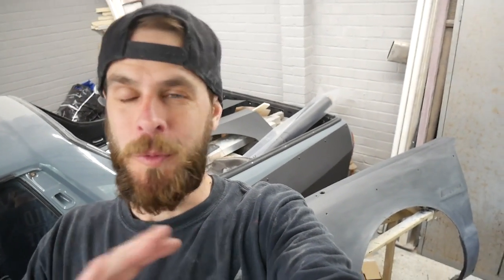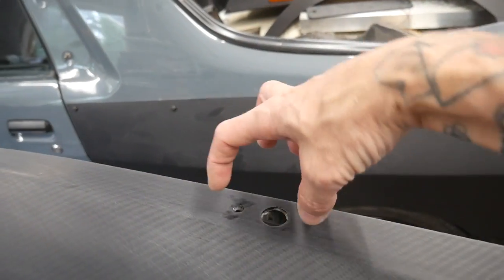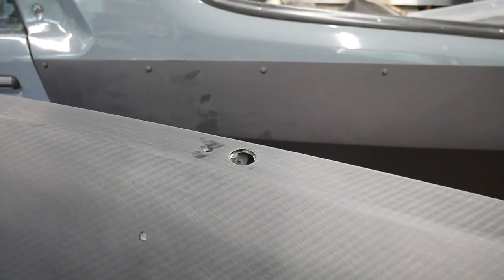I'm not going to bore you with a pure sanding montage because that's most of what this is — that and drying times. Quick recap: put the base coat on, let that dry about three hours; put the skin on, let it dry about eight hours; two layers of resin, left it to the next day; flatted it; another two layers of resin; rested the next day; flatted that — that's where we are right now. One more layer of resin after that, then the final flat and polish — I'll probably do the finer polish on the car because it won't be whipping around. The front and top surfaces are getting the most attention since you won't see the underside.